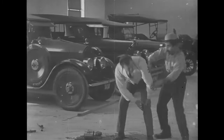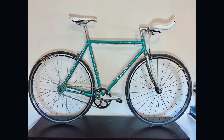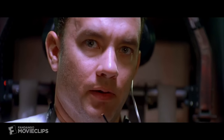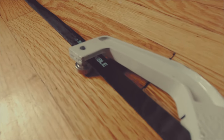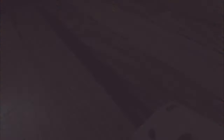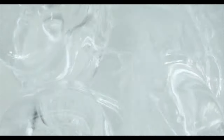The seatpost was stuck. I've worked on a lot of bikes through the years and never gave up on a project because of a stubborn seatpost. I tried everything: copious amounts of penetrating oil, brute force with a pipe wrench, cutting slots in an attempt to fold the seatpost onto itself. I even tried pouring boiling water on the frame to get the steel to expand, then plunging the exposed parts of the seatpost in salted ice water to get it to contract rapidly and hopefully separate the two pieces. But nothing worked.